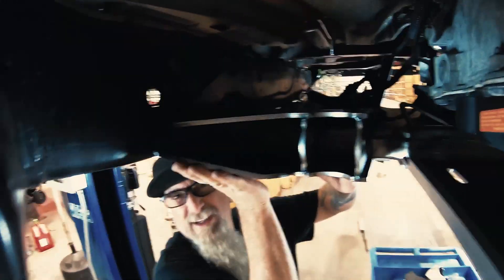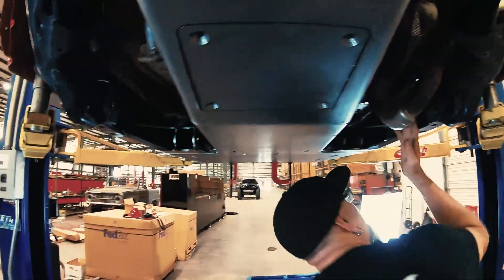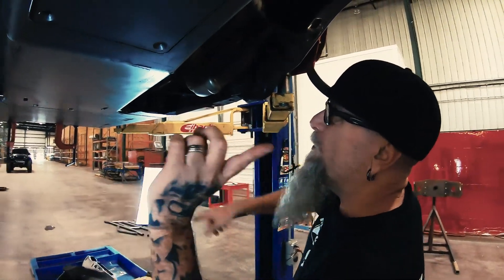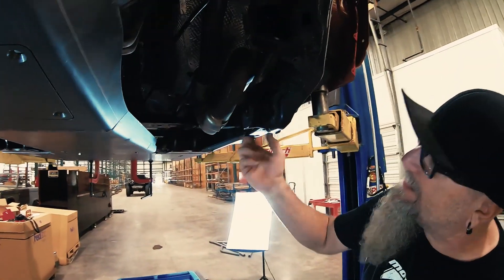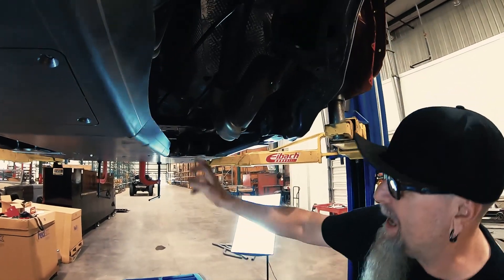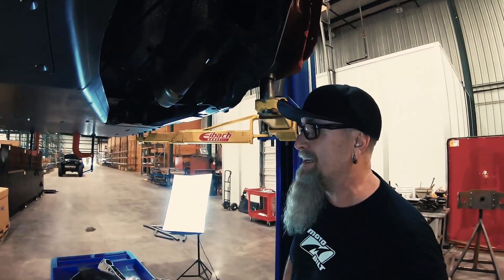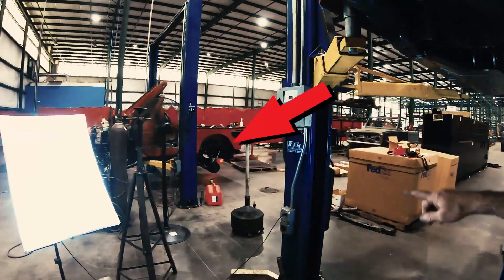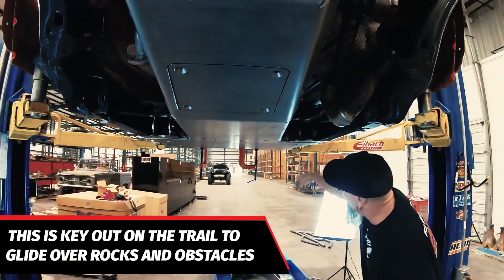Nice and smooth, even the little skid for the top of it. We just got that in. I'm going to have to cut the exhaust off and probably just run one down either side. But you see these stock mount brackets? See that little chintzy thing? That's the lower. And look at how short this thing is. We've taken that, and now it's this big beefy unit. We've added probably 16 inches to the length of that thing - nice long arm - so it doesn't have that steep link angle. This thing will be badass and super smooth all the way across the bottom.